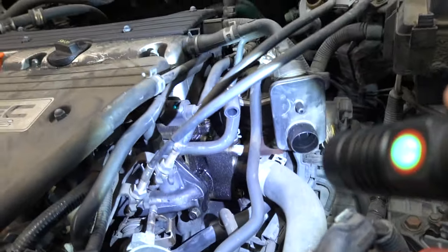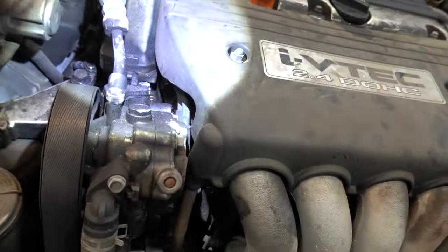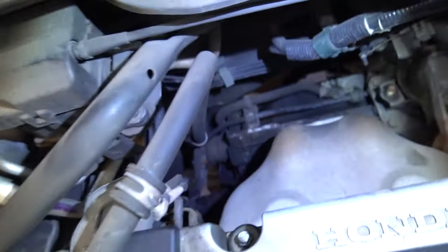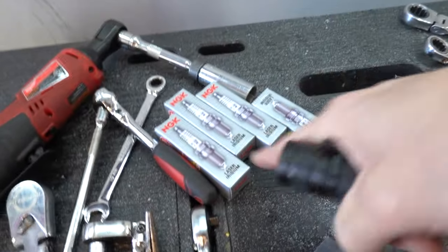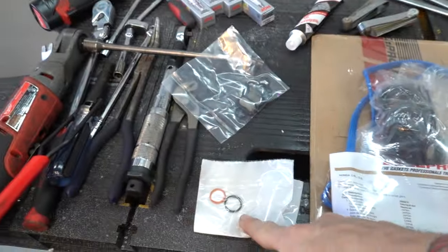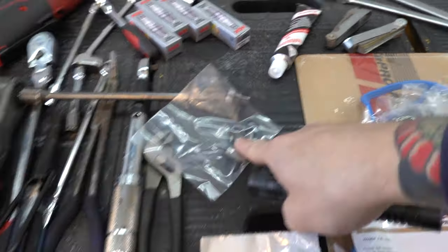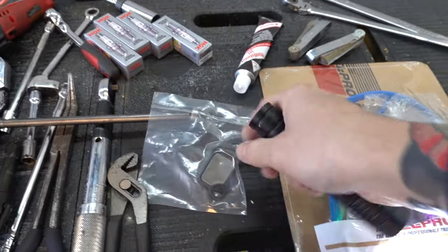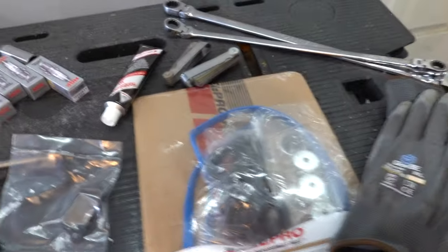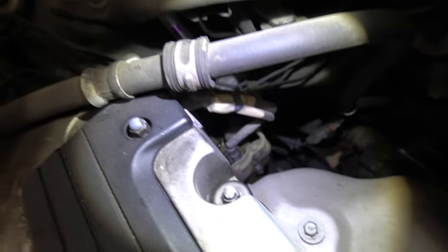As you can see it's got a bunch of oil leaks. From what it looks like, the valve cover is leaking, power steering is leaking a little, and the VTEC solenoid back there is leaking its brains out. So I got some spark plugs, Honda Bond, a valve cover gasket, a power steering O-ring gasket, and the VTEC solenoid — some off-brand from Amazon, Dorman or Delphi.